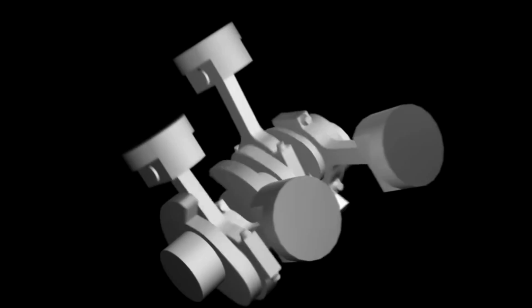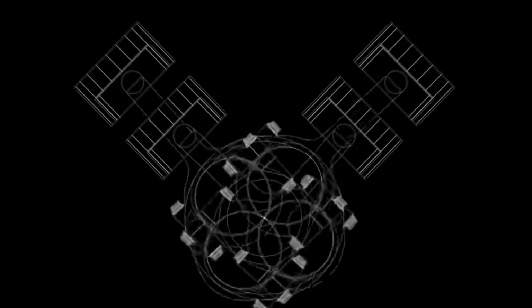In this video, we will be tackling a carburetor synchronization process on this 1999 Honda Magna. This is a V4 style motor, 1 carb per cylinder, and since we've gone through the painstaking process of tearing these carbs apart, splitting them completely, cleaning them, putting them back on the bike, this will be the first run since that process was done. And we did do a bench sync with the carbs off of the bike, but now it's time to properly sync these carburetors once we hear the bike running and use an actual synchronization tool to make sure that we are perfect.